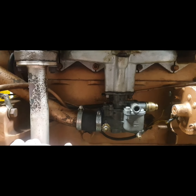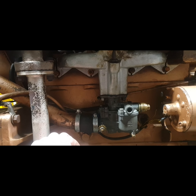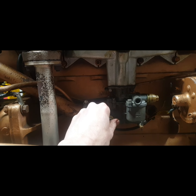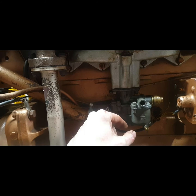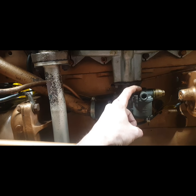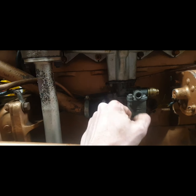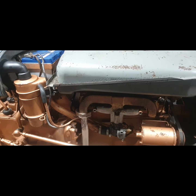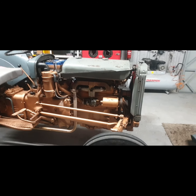I always like to have my fuel pipe making it as easy as possible to flow with gravity — it's a bit too long but hasn't given problems so far, so I'll try it for a start. Lately what was happening was it would tick over really badly, nearly cut out, and throw out a lot of black smoke. I'd say that was sediment stopping the needle valve closing completely, and it leaking meant it was slowly over-filling the float chamber the whole time.